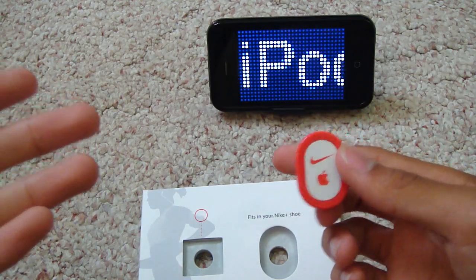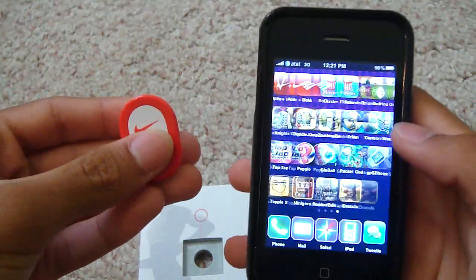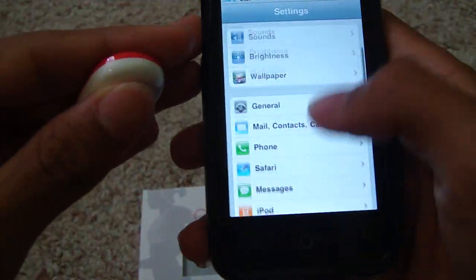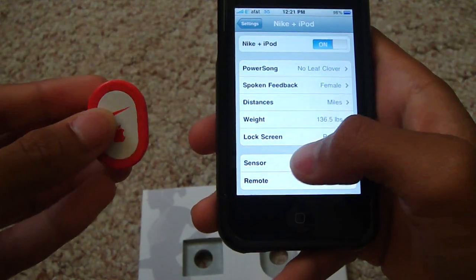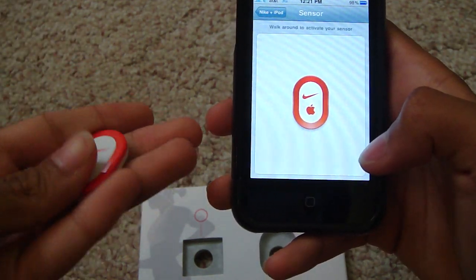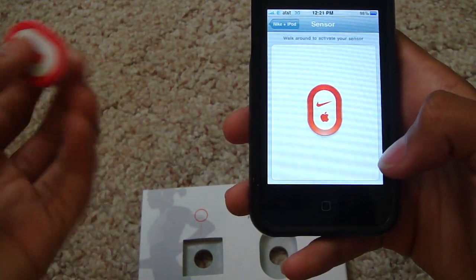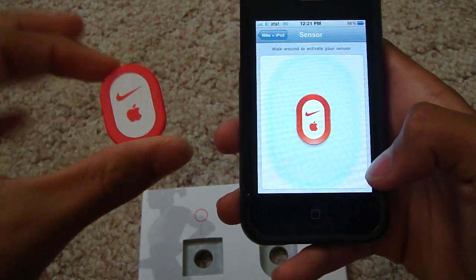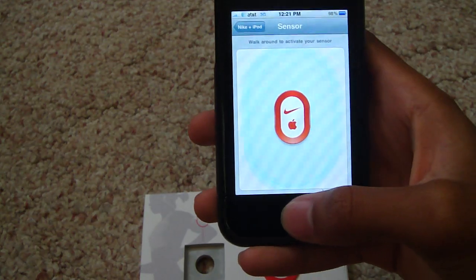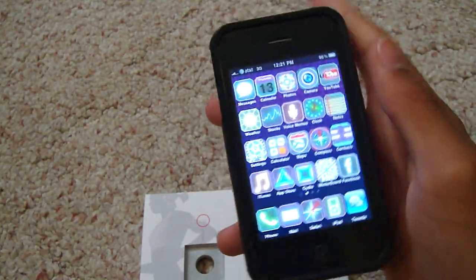The other disadvantage is that this thing sometimes does not connect to the iPhone. I'll show you what I mean. You go down to Settings, Nike Plus iPod, and Sensor — it's going to want to track the sensor, so you link a new one, and it tells you to walk around to activate it. I walked around for about 80 steps and it still didn't track. I had to shake it around a lot. It took about 20 minutes total for me to get it activated, which was another disappointment. I heard a lot of people had that problem too — they said to just reset your network settings and it should be fine.